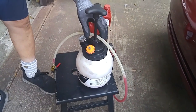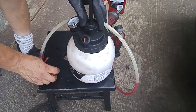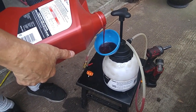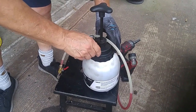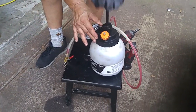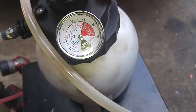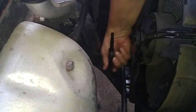Here's the transmission oil pump with a valve on one side and a fill port on the other. We're going to pump in 4 quarts as per the manufacturer specs for this car. This container holds 3 quarts, so we'll need to revisit it. Now we'll pressurize it — make sure the check valve is off. We've got it to 20 psi. This is the adapter we'll connect to the supply side hose.